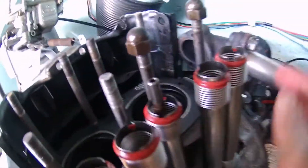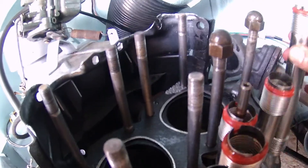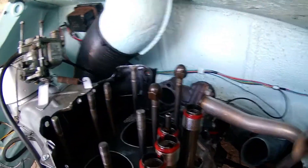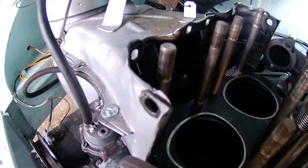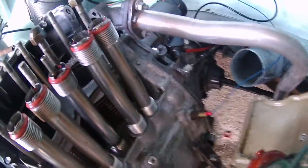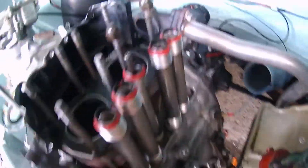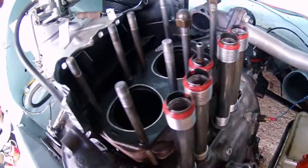There doesn't seem to be too much pinching around here but it does look like there was oil coming past there. I'll replace that seal — I've just dropped it out of the bottom — but we've got good flow to the top end, so we'll have a new cylinder head gasket on there once this is done. We do unfortunately need to pull it out and replace the clutch as well, as we've got quite a lot of clutch judder — there's possibly a warped plate in there.